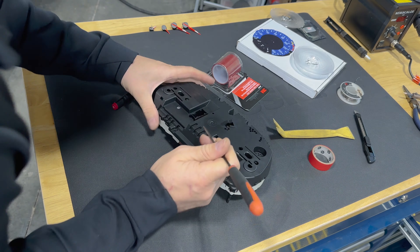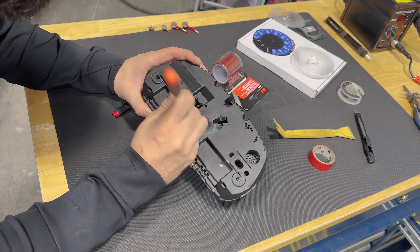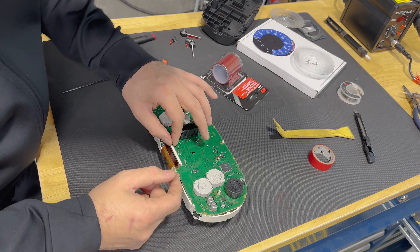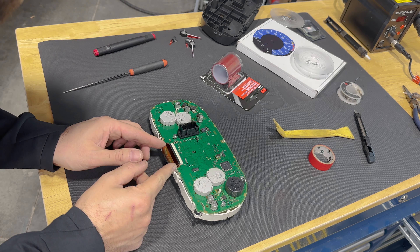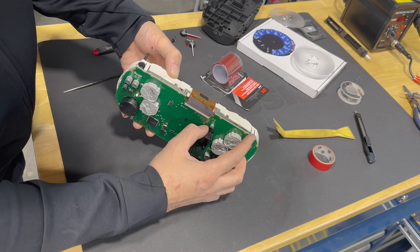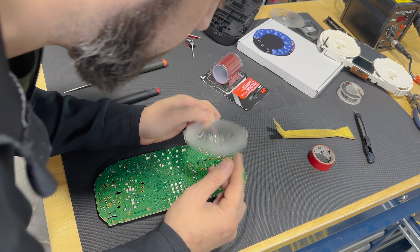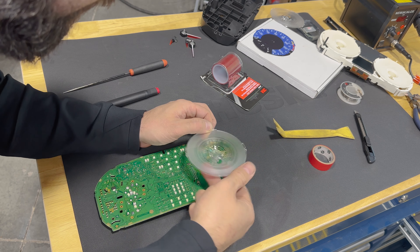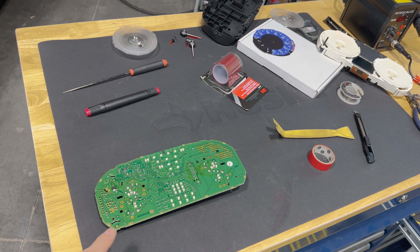Taking these off — you want to get to the circuit board. To get to that, you just basically go inside here and release some clips around the connector, and take the board out. This design is slightly different than the E90. What happens is light gets diffused through here — it takes the light of these three LEDs and this one over here, which are orange, to light up the needles and this whole ring. On the E90 there were six; I only see four here, but I'll get started removing them.